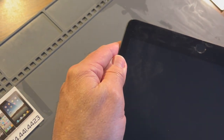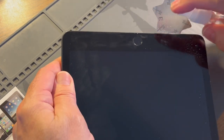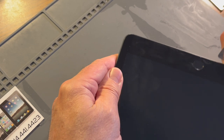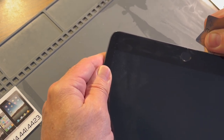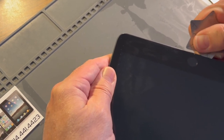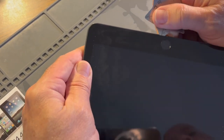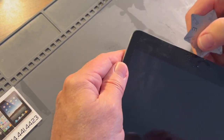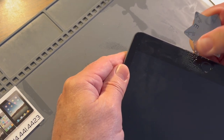I'm going to run this right up to the home button. I know on this side of the home button we're safe. There are some wifi antennas underneath right about where I'm at right now, but on the 6th, 7th, 8th gens — which is what most people are working on — it's not really too hard to work around those. On the earlier models, like the iPad 2 and 3, you really had to be careful because the wifi antenna was actually adhered to the backside of the glass.